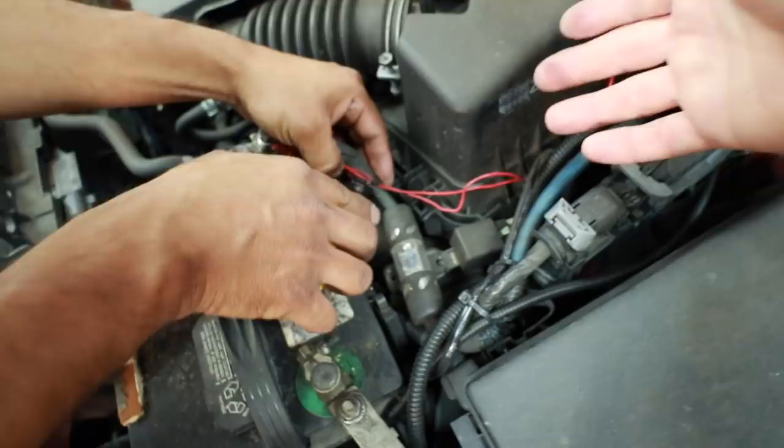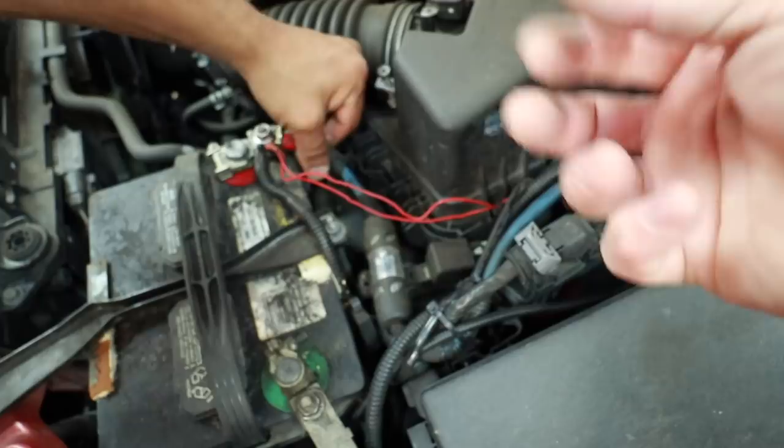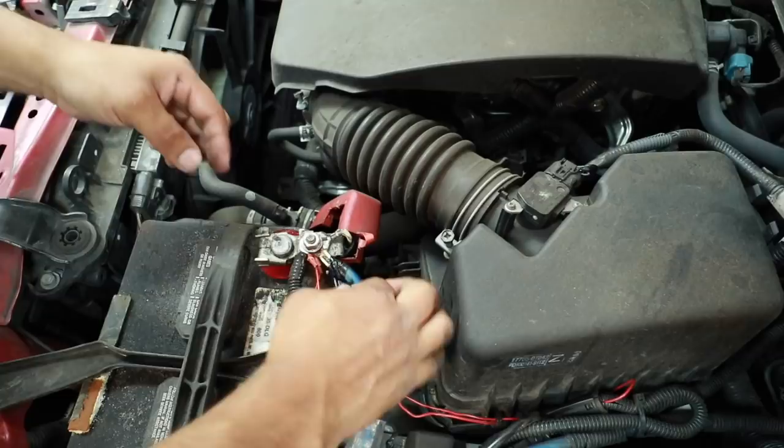I know what you're thinking — how can you tell the difference between CCA and copper just by squeezing the wire? I've felt enough CCA wire to know what it feels like. It just has this feeling to it. I wonder if it'll just pull out. It's a good crimp — not a great crimp, but it's in there pretty well. Still, we have plenty of wire outside. You really don't want to do a crimp like this.